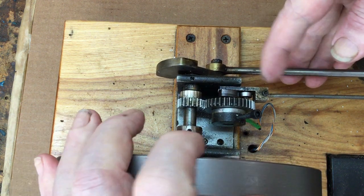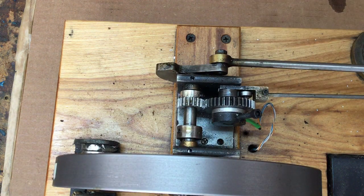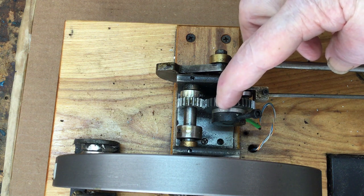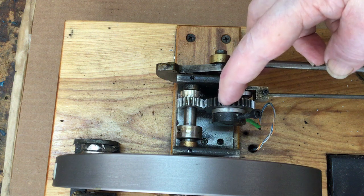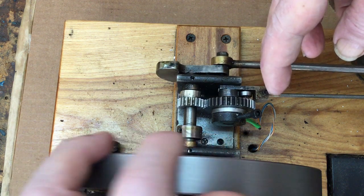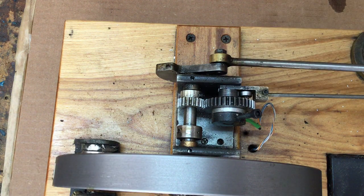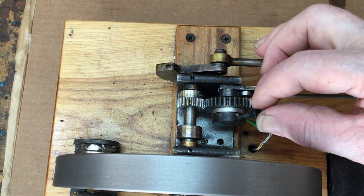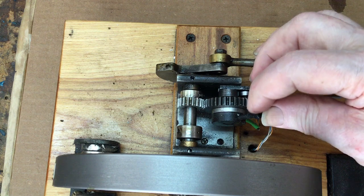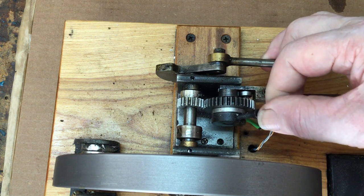This over here is the push rod that actuates the exhaust valve. There is a lobe on the camshaft which, as you rotate it, comes around and activates that push rod to open the exhaust valve. This set of wires goes to the ignition circuit, and in this plastic sleeve there is a Hall sensor connected to those wires. In that aluminum disc there is a small neodymium magnet, and as the camshaft turns and the magnet passes the Hall sensor, it sends a signal to the ignition circuit underneath to fire the spark plug. The screw sticking up out of the top allows you to rotate this sleeve back and forth, which lets you set the timing — moving it more vertical advances the timing, and moving it more horizontal retards the timing.